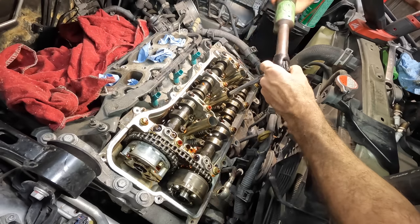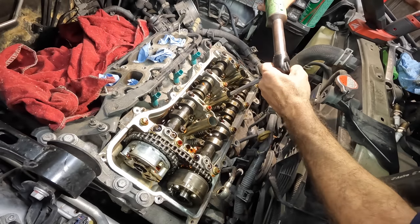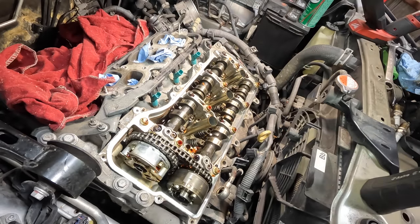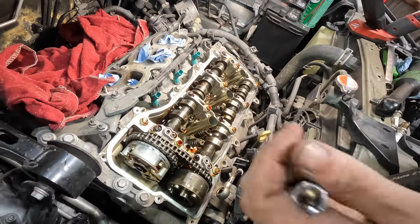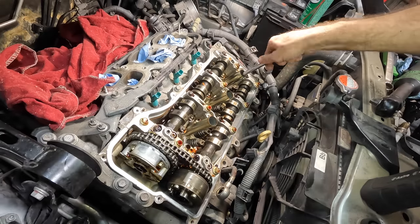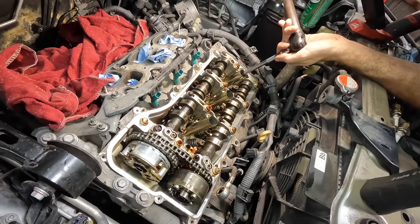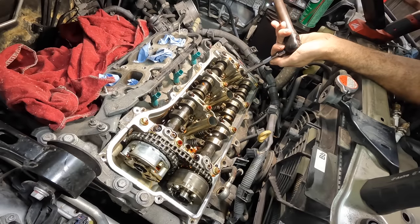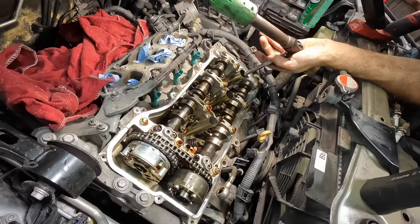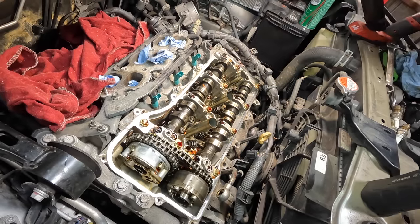If you full send it, when it bottoms out, it can actually torque the socket and break the spark plug, which would not be okay, especially on the cylinders in the rear. We don't want to break that. Then I got to do it again. And I don't want to. That one's in. Trigger control. Click right there. All right, three down, three to go.